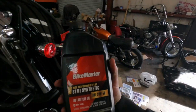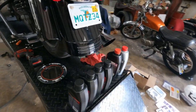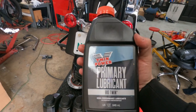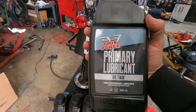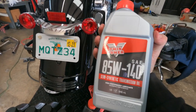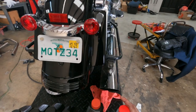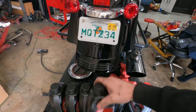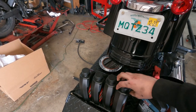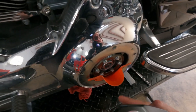For the motor oil I'm using semi-synthetic — get four quarts for the oil. For the primary I'm using Twin Power big twin primary lubricant, and for the transmission I'm using 85W-140 semi-synthetic transmission fluid, all from Twin Power as well. You can run 20W-50 in all three holes if you want.